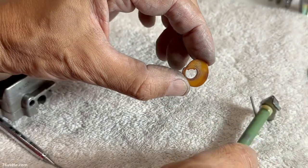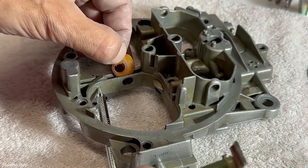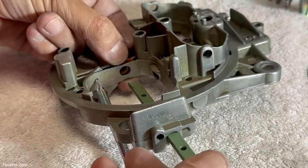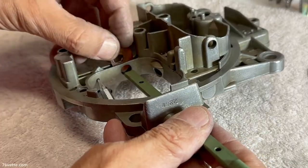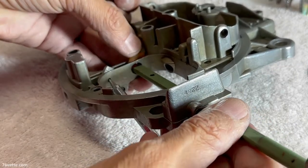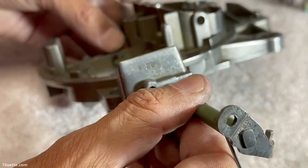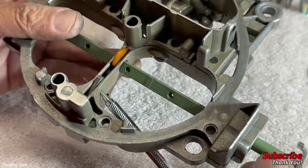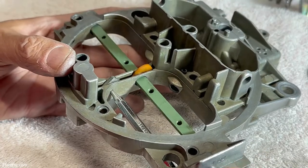This is the position where you want this cam to be in. You would insert the shaft through here, and then what you're trying to do is kind of line it up with the half-moon shape on this little plastic cam. Just be patient — you do not want to apply a lot of force here. Once they line up, the shaft will go through. Once it goes through, you're able to push this all the way in, and as you can see immediately, the cam starts operating correctly.